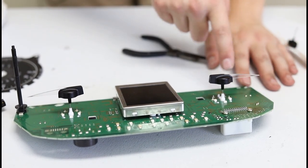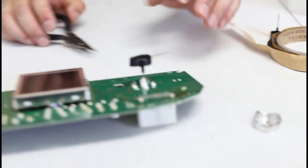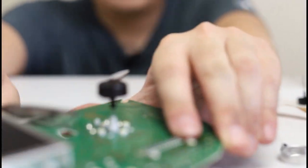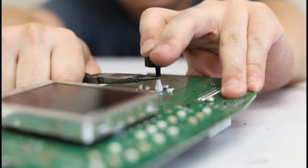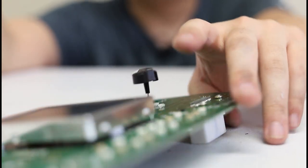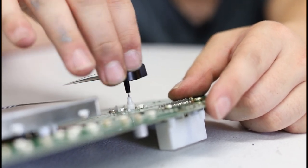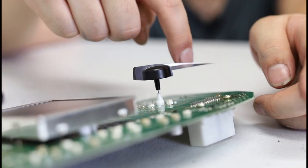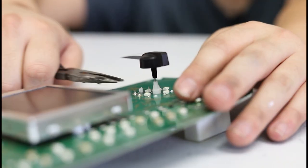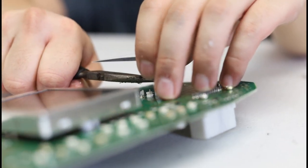If the magnet is pushed too far in, the motor spins freely with no resistance — we don't want that. To fix it, grab your needle nose pliers, push the needle all the way back down to the very bottom, then do the same thing you did to get it out — tug slightly upward until you get the right amount of play. Make sure it really spins freely and doesn't get caught on anything. Grab the pliers, hold the shaft, and separate the needle. Now the motor is reset and we're good.